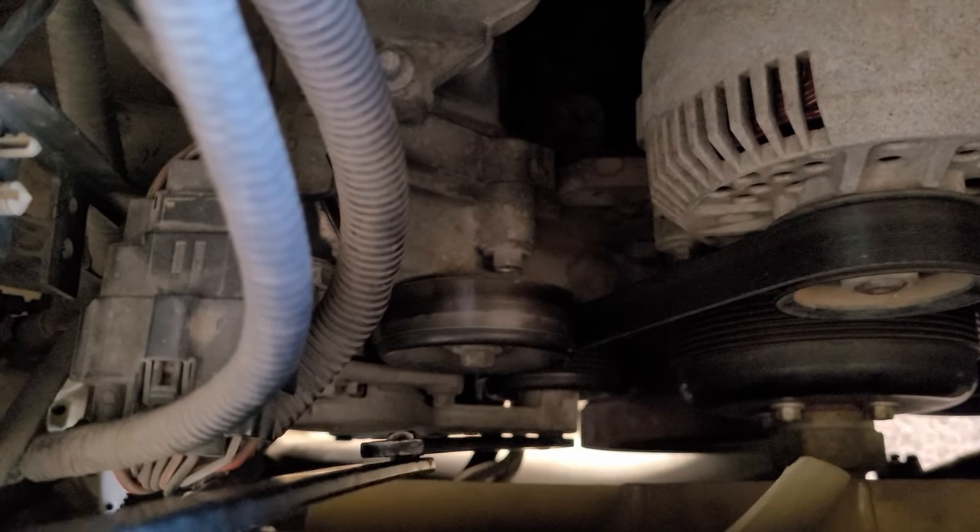Next you're going to want to dust off or replace your air filter — mine's still got some life in it so I'll keep it. This clamp here — you're going to have to fight with it a little bit. What I find works best is to force it open wider than it wants to be, rotate this notch so it lines up in this little cutout, then grab your clamp and start to rotate it back and forth until it settles into a spot. Then loosen it part way, get this part pushed in, and tighten that clamp back up. The duct system's back together. There was a carbon filter tucked down in here — push the tube back on the nipple and let it wedge itself in. That's in there nice and tight.